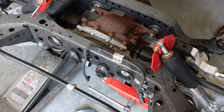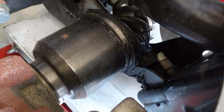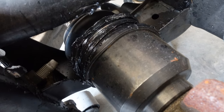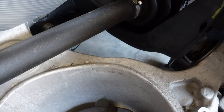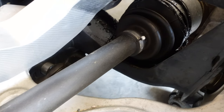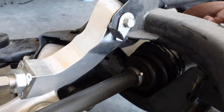We're gonna get those half shafts out and get them sent off. Let me show you the damage to them. This one - the boot is all twisted up in there. They don't look too good. And this one over here - the boot is just all busted up, covered in grease so you really can't tell. But I think it could be just the boots. The shaft itself stayed intact so I don't know - we'll see once I get these axles out and can peek in there. There's some other bushings that can be replaced while we've got it out.